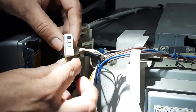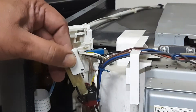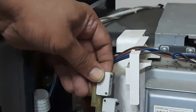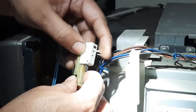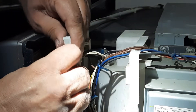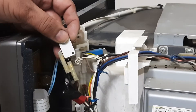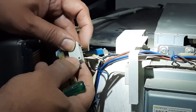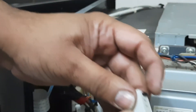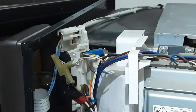Be very careful — these are plastic locks. If you see this, this switch doesn't have that functionality; the plunger is not above the level as the other one. So that's the malfunctioning switch. Let's remove the connector. This connector needs to be removed, and you see when you try to force this it comes out sticking again — it's not clicking freely. It's jamming and coming out, so this switch is defective.